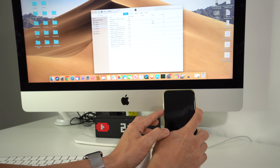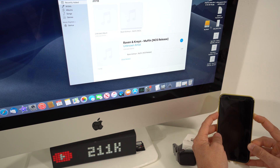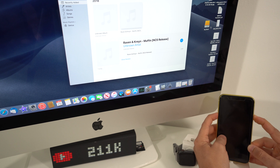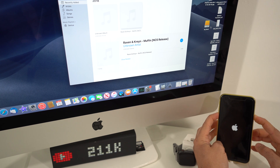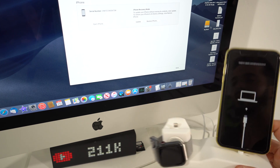So it shut off. Now I'm holding volume down as well, along with the power button. You're going to wait about 10 seconds and then release the power button and the volume button and press them again. One, two, three, four, five — let go and press them again. Volume down and the power button. Continue to hold them both, and you will see this menu right here.